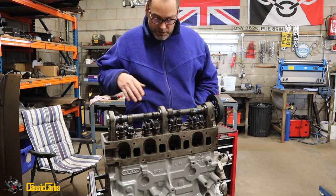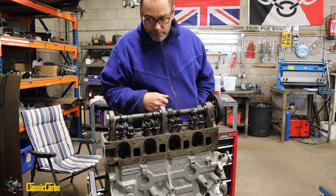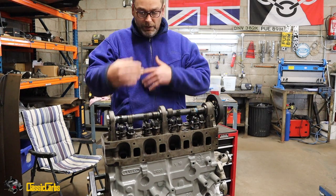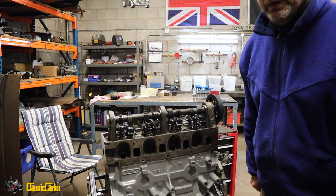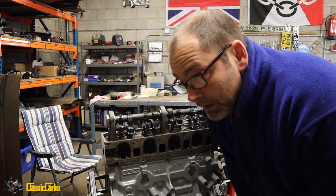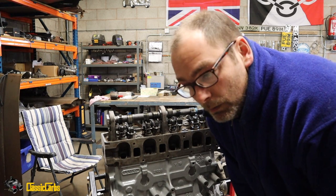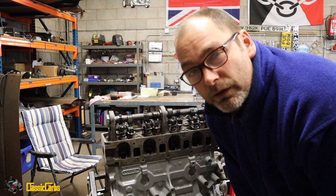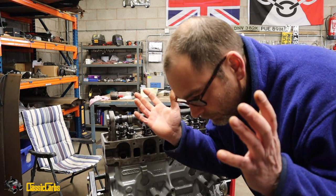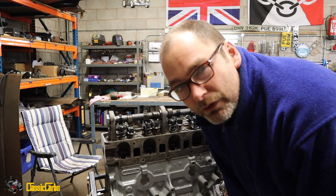So anyway, I'm going to spend another 7,000 hours familiarizing with this in the head, and then we'll probably pop it off, bring the old one in and start drilling grooves on the pistons and CCing those, and on and on. But when you hear about good horsepower engines and you think, how can these guys do it? It might be because they put in the time on these very simple things, but they can be tedious and difficult, like the calculations for the compression ratio. My mind just goes cabbage, because there's all these numbers and figures and trying to understand what you're trying to do.